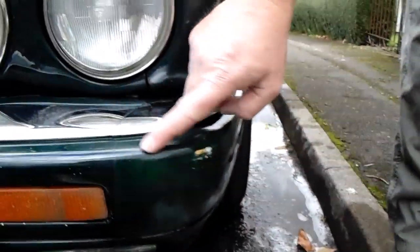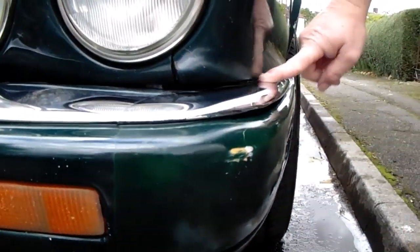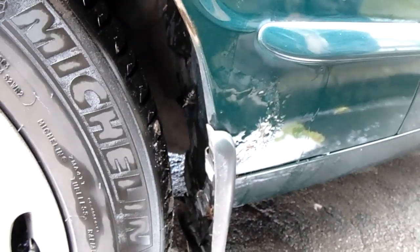This part, somebody's had a go at repairing at one time before, because you can see their masking tape lying down there, and they've tried to repair the corner and they've hit it again, whatever it was. Even though I've washed it, you can see there's still dirt on the car. It wants really washing a second time. And then we've got the repairs round here, which you can see better now the dirt's all off. And then that big ugly bit down here, which is a big old chunk. We'll see what that's like. We'll have to take the wing off, I reckon.